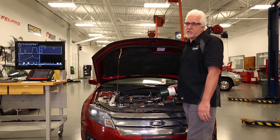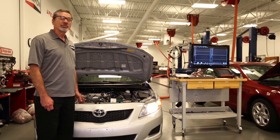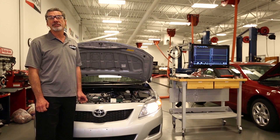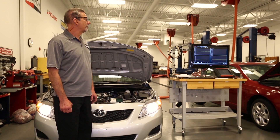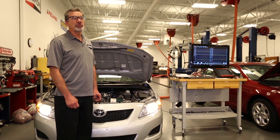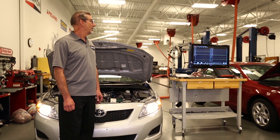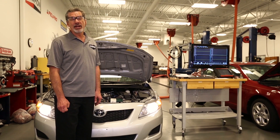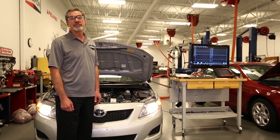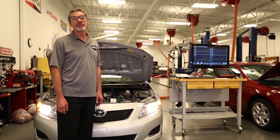Next we want to look at our wide range air fuel sensor. We're now looking at the wide range air fuel ratio on this Toyota, and you'll notice that things react a bit differently than they did with the conventional O2. The data in the top left represents the short-term fuel trim, and the trim values are almost dead flat — a very even, tightly controlled air fuel mixture. In the bottom right corner is the air fuel sensor voltage, and again you don't have the regular oscillations we saw earlier with the conventional O2. This sensor allows a much tighter control of the air fuel mix being delivered.